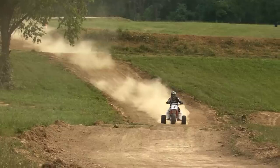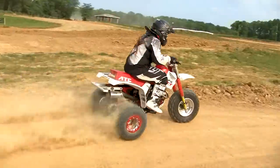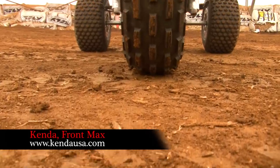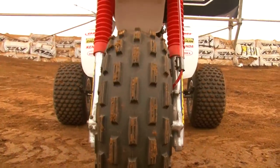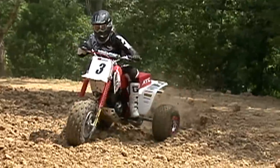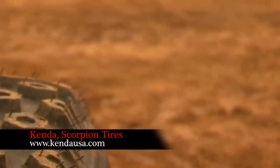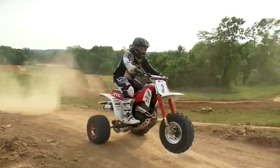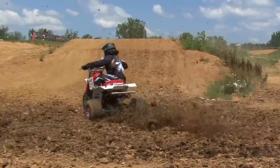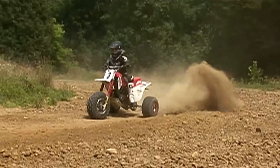The steel braided lines enhance the brake's power and feel, while their various line and fitment color options let you customize the look of your machine. Kenda's Front Max and Scorpion rear tires have been around since the three-wheeler days. The 23x5.8x11 front is an uncommon size due to its 11-inch wheel diameter. The Max features rows of perfectly vertical knobs for good directional control — the knobs are tall for good hookup on soft tracks, while the top of each lug features vertical grooves aiding in traction on hard-packed surfaces. The Scorpion rear tires feature closely spaced diamond-shaped dimpled knobs with more horizontal and less vertical edges, providing more traction while accelerating and braking, and less traction for sliding through turns. These tires feature a harder rubber compound than most modern motocross tires, which also helps them slide more easily and last longer. We went with 18x9.5x8s for a motocross-appropriate height and the narrowest possible width.